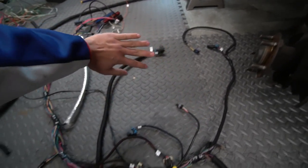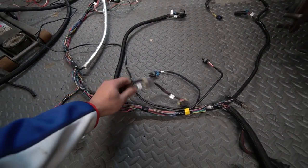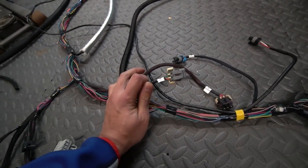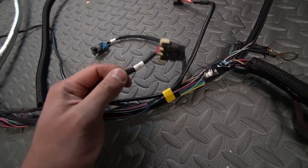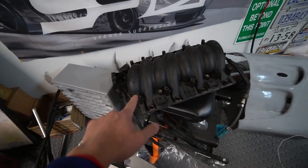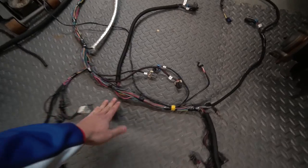That's basically behind the engine right there. Coming in the middle of the engine, right behind the intake manifold, you got the MAP sensor — Manifold Absolute Pressure sensor. You absolutely need this information to calculate air density and so on. You also have the cam position sensor connector and the knock sensor. These three are going to be installed right behind the intake manifold, and luckily we have the intake manifold — that's the front, that's the back — and that is where those connectors will be installed, right there on the left side of the intake manifold.